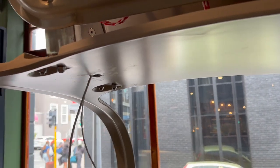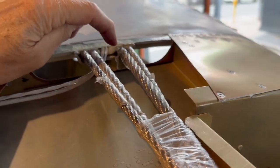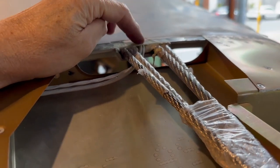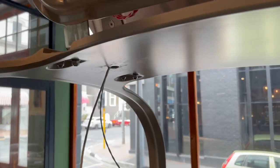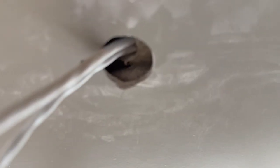The main thing that might be a little interesting: we intend on putting our light switches up the top here, so I've run some wiring down through the center — it's actually pretty easy. With the latest canopy there is a channel here — I believe it's designed for oxygen — that runs all the way out to the front. One little trick for young players though: you'd think it's just one layer through here and you'd be into it, but you'd be wrong. That channel is actually attached to the top, not the bottom, so you have to go through two layers to get in there — but other than that it's a piece of cake.